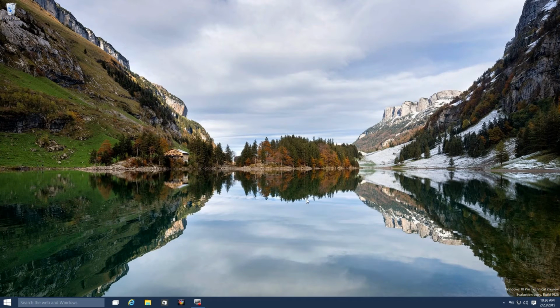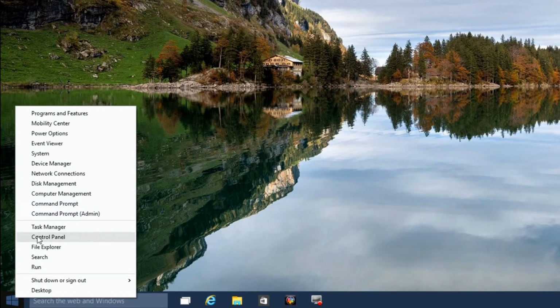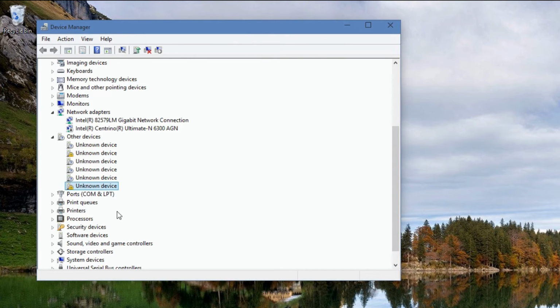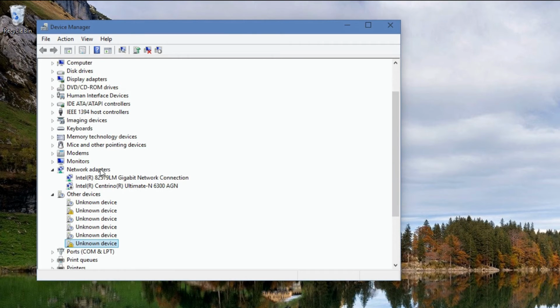Okay, so if the printer itself is fine and the connection is fine, then obviously the problem's on your computer. So at this point, if you haven't already done so, the first thing really is to restart the computer. I know it sounds obvious, but the number of times that's fixed a problem, well, it's a lot. If you've restarted your computer and you're still having a problem, we can look at Device Manager. We're going to right-click here on the Start button and go to Device Manager. What you're looking for here is any yellow exclamations like this, or any red X's that might give you a clue that there's something wrong with the printer software. And if there is, then you could try uninstalling and reinstalling the printer software. Again, be very careful when downloading anything off the internet.